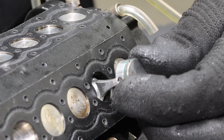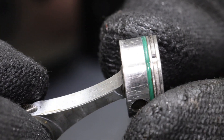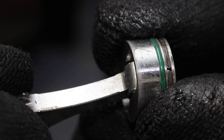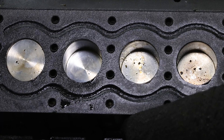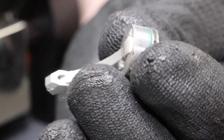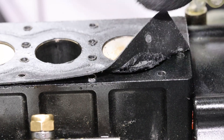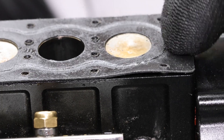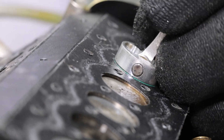Now things are starting to make sense. This is one of the pistons — there's just one rubber ring, which is probably for the oil, and one compression ring. I can totally see why this thing lost compression over time: this ring is just wearing down, the gap is getting bigger and bigger, and compression is getting lower and lower. I don't know if this engine will see the light of day again unless I get new rings from the manufacturer and re-ring the entire engine. Also, this head gasket doesn't look the best — it's just compressed paper. I'd do this differently, maybe a sheet of copper. That top piston ring is loose — it's not doing anything.